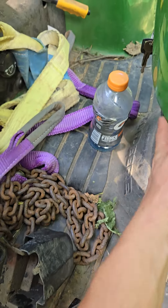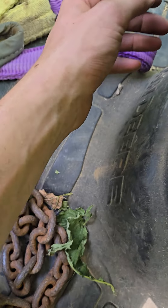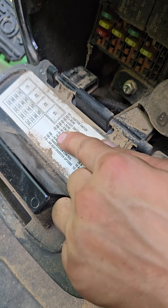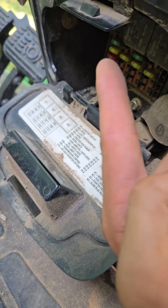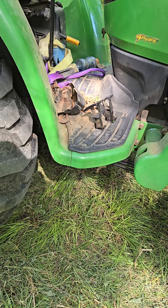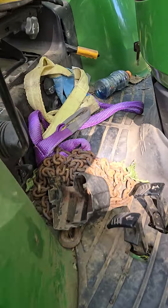Pull that off and that's fixed. Of course, if you're trying to do the easy stuff first, check your fuses. In our case we checked and it was the transmission fuse — F-09, which is the transmission control. Put a new 10-amp in there, that red one right there. But ultimately, check your sensors — that turned out to be the problem. Thanks y'all.